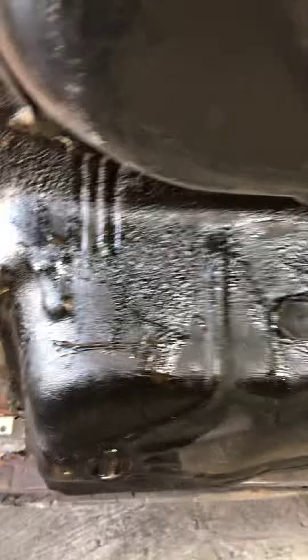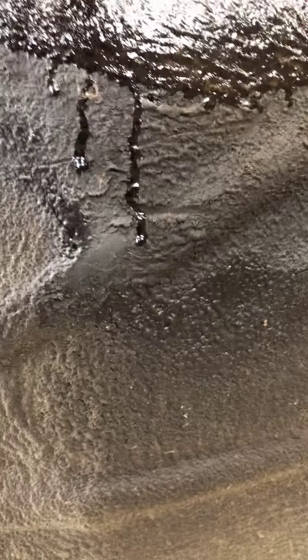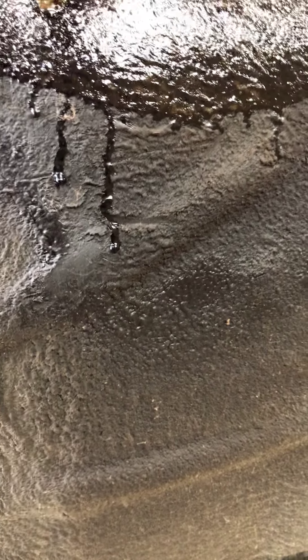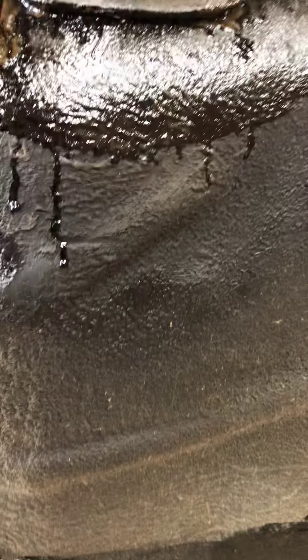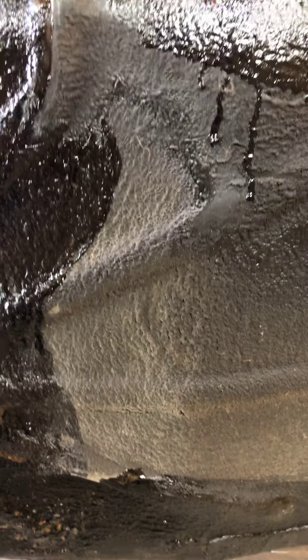It's kind of like a gel — just painted it on. I didn't hit every single spot, but I hit some areas like under here where my floor pan meets my original body. I want to weld that, but it had this buildup of black stuff. To me it has the consistency of almost like tar. I'm pretty sure it's factory, but I could be mistaken — somebody could have sprayed some kind of undercoating on here.